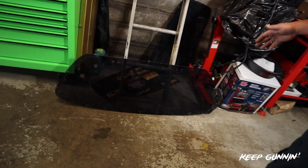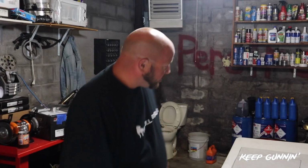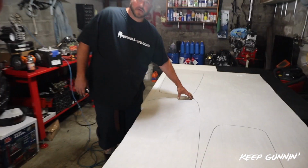Jeremy is going to start cutting up the carbon fiber. What's the process here? You measured it out. I traced the existing Lexan, which you had in your car already. Yes, sir. Transferred those patterns over to the carbon fiber sheet. Through my rack on it, we're going to cut it with a high-speed wheel to not splinter the carbon fiber.